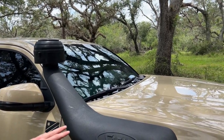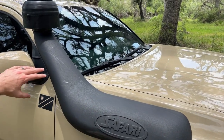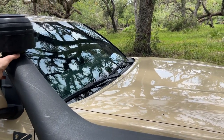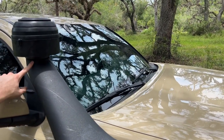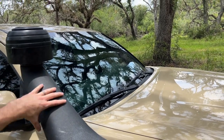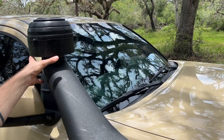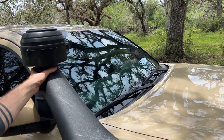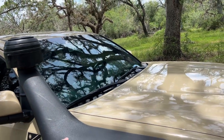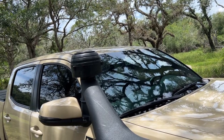The second reason I selected the Safari Armax snorkel is that I think it has one of the biggest intakes, which in this case is four inches, where some other brands that are a similar style have only about three and a half or three inches of air intake. So this one has the largest opening and large volume for the air to flow through and get to the engine without being restricted in any way.